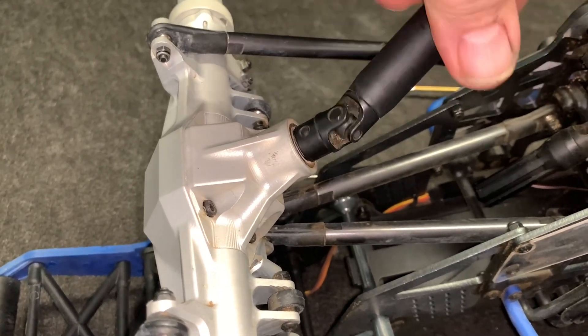Hopefully you guys liked the video - the driving part - and maybe I was able to show you some things with the axles. If you have the noises, maybe you have an idea where to look now. As far as the shims go, I'll try to find some on eBay - hopefully I'll remember to get those in the description. The sizes are 6x8x0.2mm, 0.3mm, and 0.5mm. I'll see if there's an assortment and if there is I'll get that linked down below to make it easy for you guys.